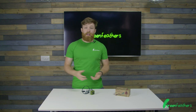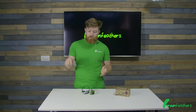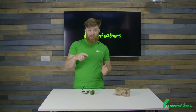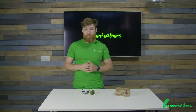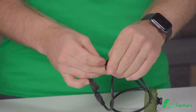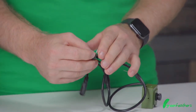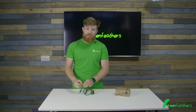The next thing I'm going to touch on is when you're setting up the camera in the app and you're searching the network — as it's going round and round in the app, if it doesn't find the camera we might want to reset it. You can do this by taking the cap off of the little white button and pressing and holding for 20 to 30 seconds. You should hear a little click from the camera, and that lets you know it's reset. Then have another go after this.